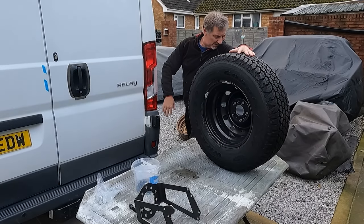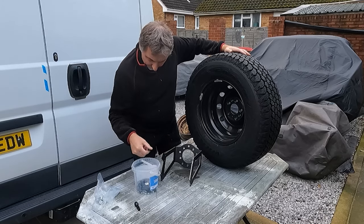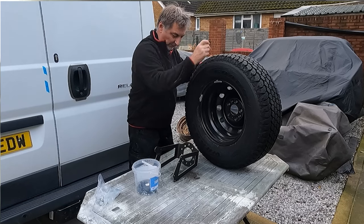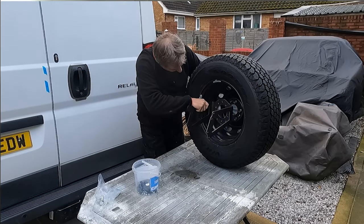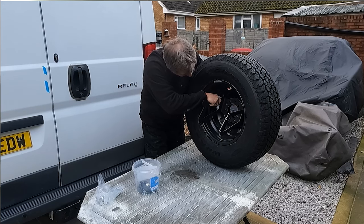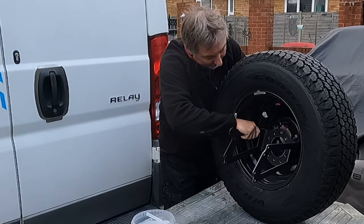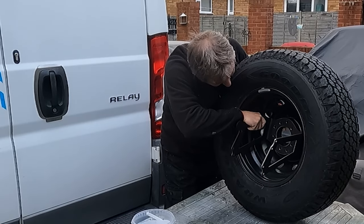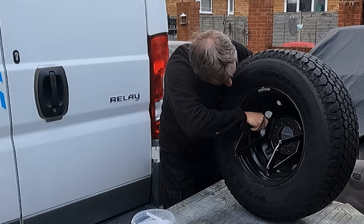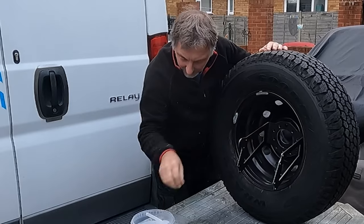The wheel boss in the kit is drilled out to accept standard wheel bolts. There's enough holes to accept all PCDs for the 15-inch, 16-inch and heavy-duty wheel rims. At the time of purchasing the kit, you're given the option to buy some lock-in wheel studs. I thought this was a good idea and set out everything on the bench to pre-fit everything to make sure all fitted okay. It then soon became obvious that there may be a problem when it comes to fitting or removing the wheel and tyre from the actual wheel boss, because there's nothing to support the wheel and tyre while you're doing so.